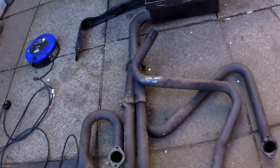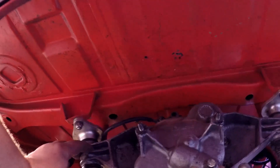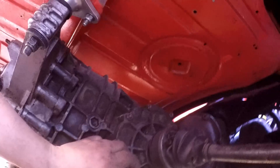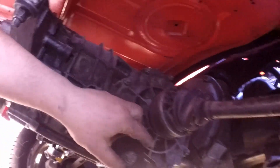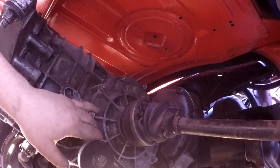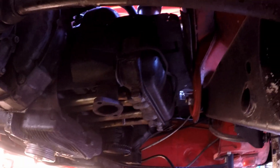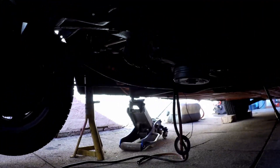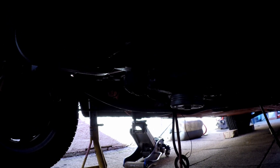We have one very nice looking exhaust, there's the rear valance. They've got some really nice mounts there — I'm going to loosen those off tomorrow. I believe everything is all disconnected as it should be. I did look it up — this is a standard item; it's quite trick how it does that. So this must be a revised 901 gearbox, probably with the diff the other way, as it's fitted the other way than the 912s it would have been in. I'm not going to undo the valve covers until I drop it. Battery and earth cables, the secondary battery and the secondary charge system — it's looking almost all there.